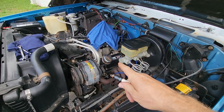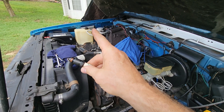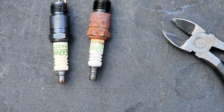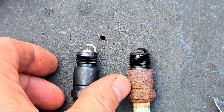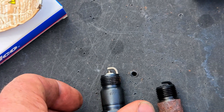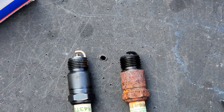When doing this I start with number one because the firing order goes 1-8-4-3-6-5-7-2, and I'm going to replace the plug at the same time. This gap looks big but this is just a stocker and we have an ignition box with triple spark, so this gap — fifty thousandths — is perfect for this motor. Here's number one — they're running a non-projected tip. I don't see why you can't run a projected tip; the projected tip in my opinion is way better for a street car as it puts the electrode deeper into the cylinder for more complete combustion.